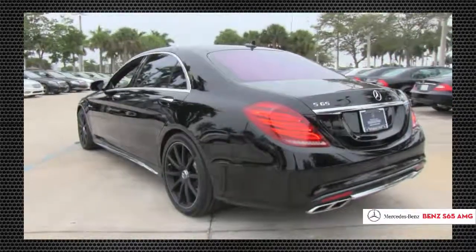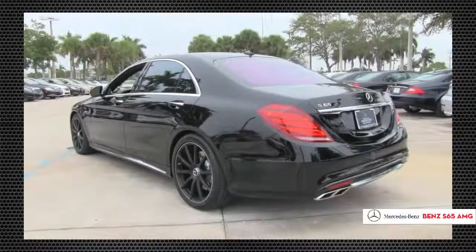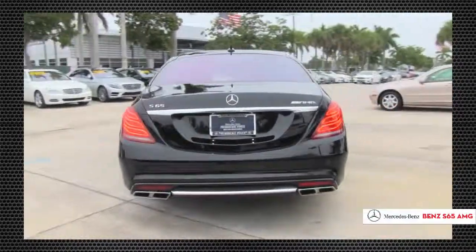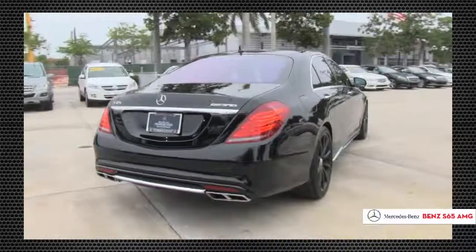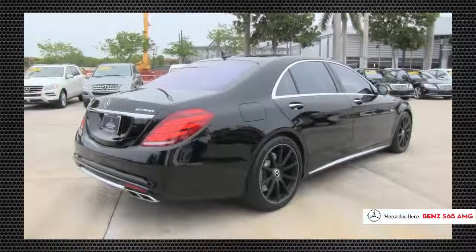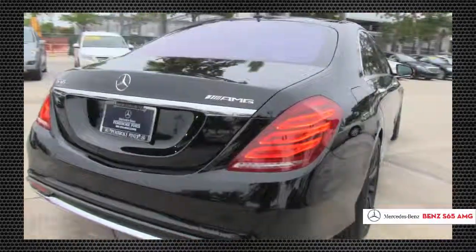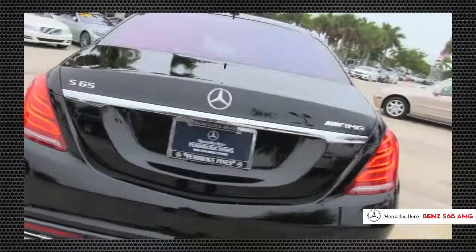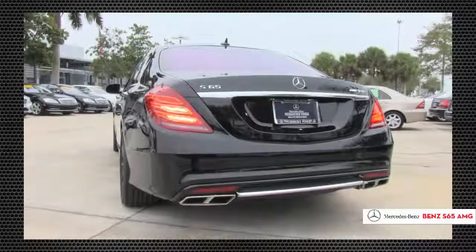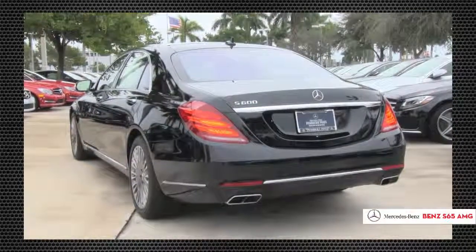Road Surface Scan works up to 80 miles an hour only when the suspension is in comfort mode and the sensors aren't obstructed, such as in a snowstorm, fog, or inclement weather. The hydraulic system allows individual automatic adjustments of spring rates at each wheel to keep the ride balanced and compensating for lifting, rolling, and pitching, varying between two driver-selectable modes, Comfort and Sport. Sport mode takes advantage of AMG's specific suspension architecture to create a more dynamic and direct driving experience.